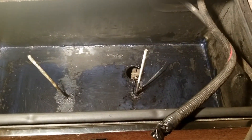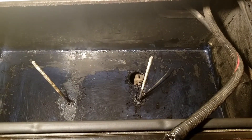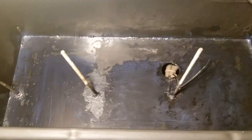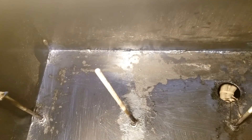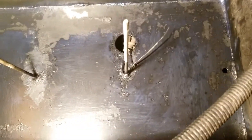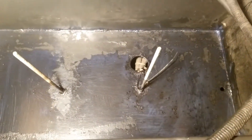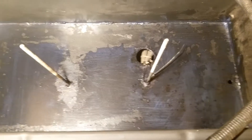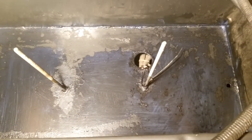It's paint day. After two coats of this Loctite Xtend Rust Neutralizer, I am very happy with how this turned out. That rust is neutralized, it's blackened as it said it would - the product does its job. Very, very happy with it. Can't wait to see it finished. You do have to use an oil base paint to go over top of it, so I have some Rust-Oleum 2X lacquer.